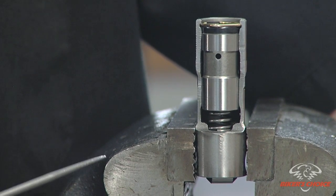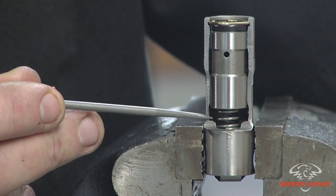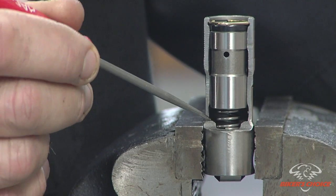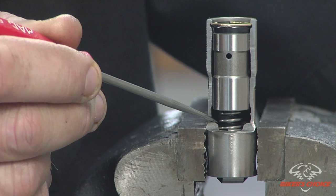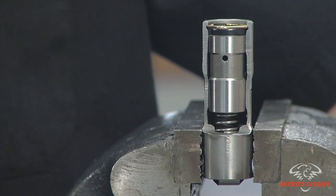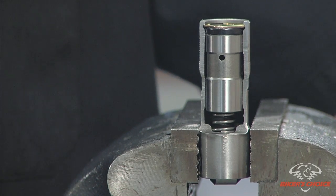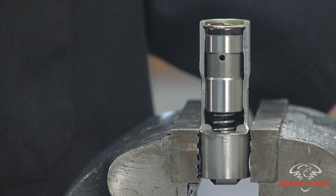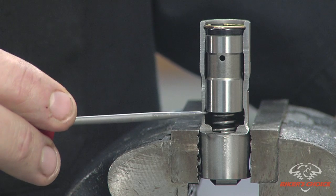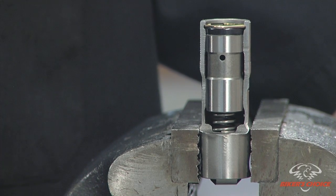What you're doing when you're adjusting the pushrod is closing the gap between the piston and the bottom of the lifter. For the lifter to do its job and compensate for the growth in engine height as things warm up and change distances, the hydraulic lifter travel has to change and take up all the valve lash so that your valve train is quiet.